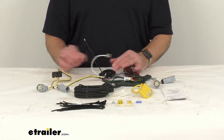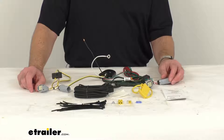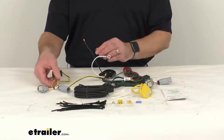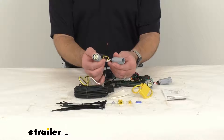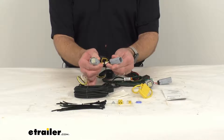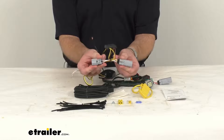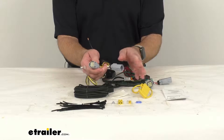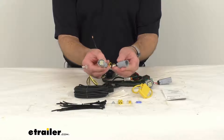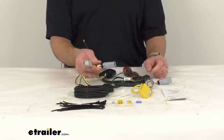The side with the yellow wires is going to go to your driver's side. You will need to locate your vehicle's taillight wiring harness by removing the rear threshold plate, the privacy screen, and some interior covering to access those taillight connectors in your Trailblazer. Then separate the taillight connectors, being careful not to break the locking tabs, and insert these T-connector ends between the vehicle's wiring connectors and lock them into place.